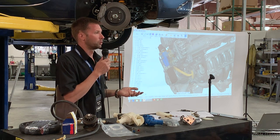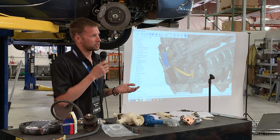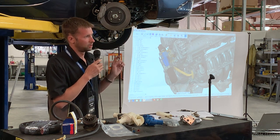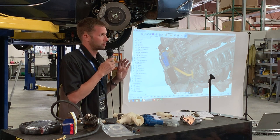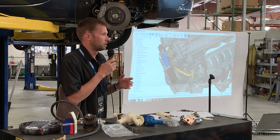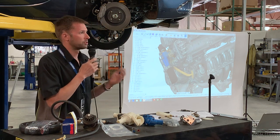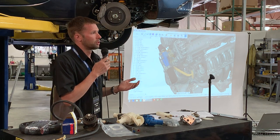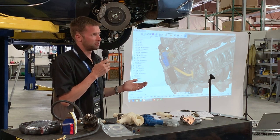As far as a coolant ratio that I would recommend for you, typically it's 70% distilled water, make sure it's distilled water, with antifreeze. That will vary for your specific conditions. You know, 50-50 is what manufacturers always recommend, but water transfers heat better than coolant does. So a 70-30 mix is going to cool better than a 50-50 mix.